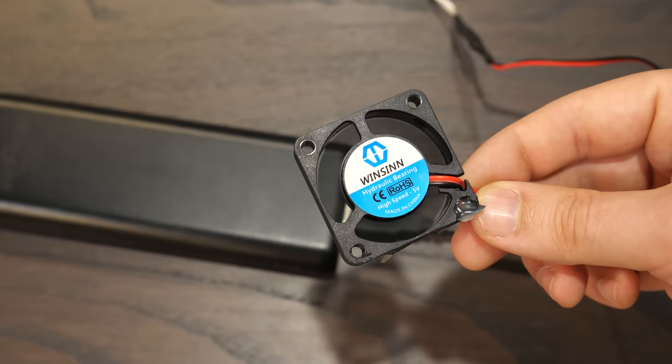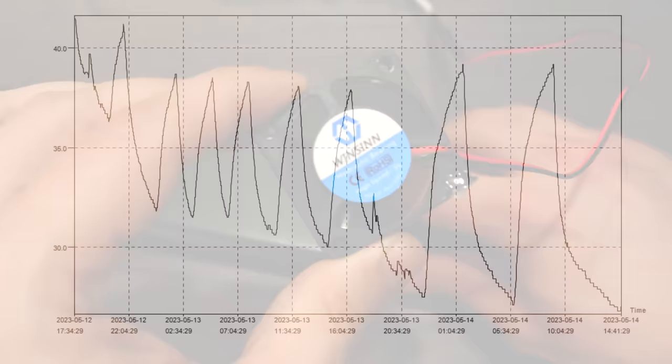The next day it wasn't running when I first checked on it — good, I thought, it's probably maintaining temperature. It kicked back on a little after 9 that morning. At 11 o'clock it still hadn't shut off. Then noon came and went. Then 1 o'clock, then 2 o'clock, and it was still running. I was starting to get pretty worried here — it was probably a bit below freezing inside by now. At 2:40 it still had not stopped running, and at that point I had to take the probes out and look at the data. What the heck is happening? Yes, I put a little fan inside the fridge — just doing that widened the dead band of the thermostat significantly.